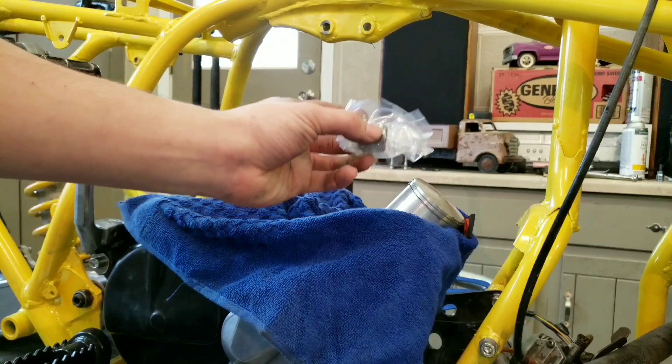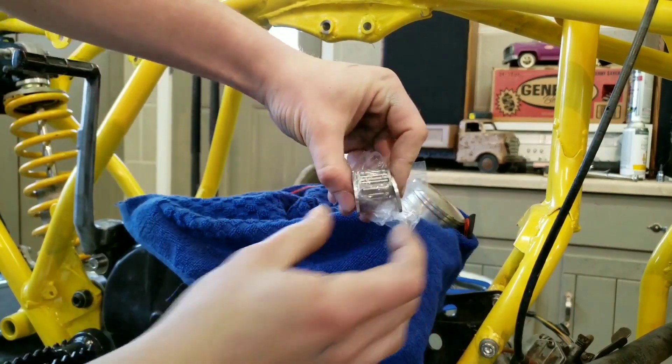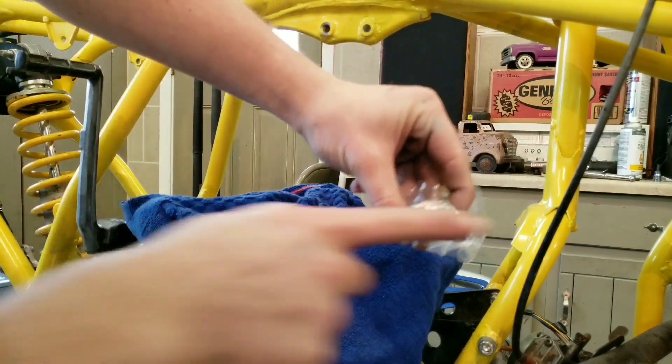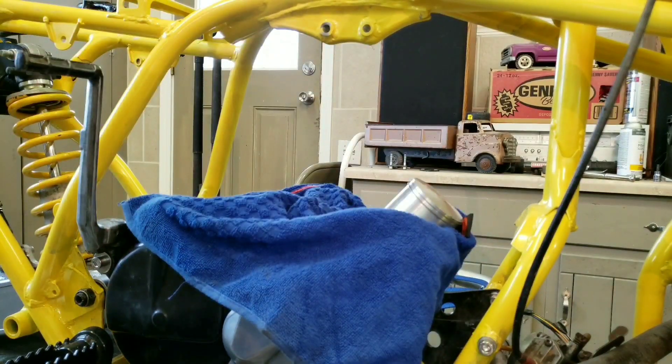What these do is: in your connecting rod you put the bearing in, and then on each end these thrust washers go in. They're milled perfectly to the right spec. They go in, then you put the race through and the piston on, and then get your circlips and everything.